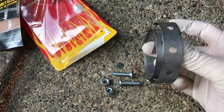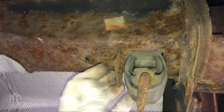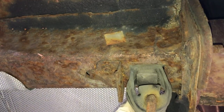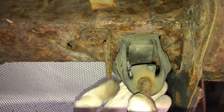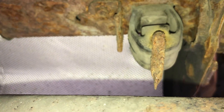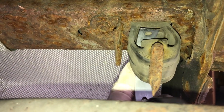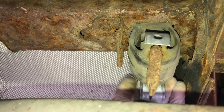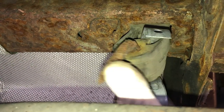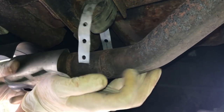This is what you can use to reattach the exhaust pipe to the vehicle. On the Mazda here, you don't have a lot of different options on where you can hook this metal strap, so you pretty much just have this insulator that you can pull the metal strap through, and that will hold up the exhaust pipe again.